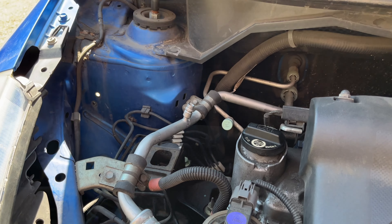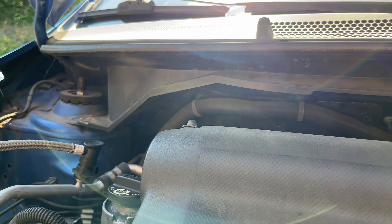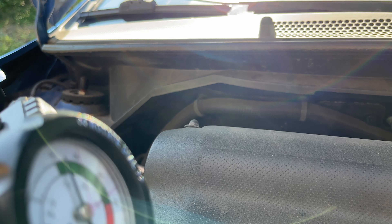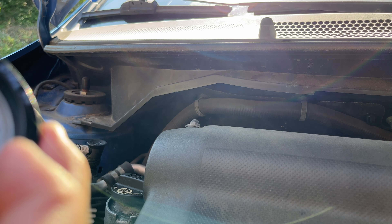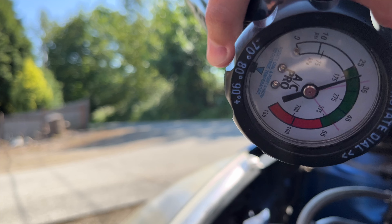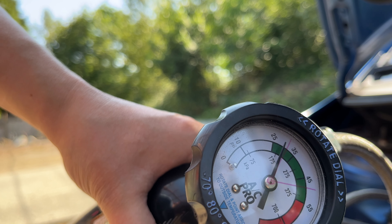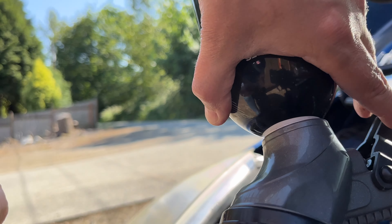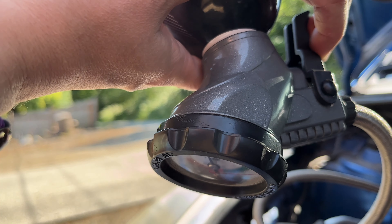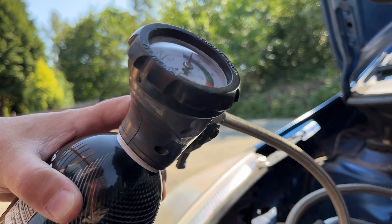This is me doing this all solo. I just pushed that nozzle down, popped it on and it locked right in. Now you're gonna tilt that can of refrigerant upside down when you go to fill it. But first check your gauge and see where it's actually running. My car has been warming up per the instructions for about the last five minutes, with the AC running on high so the compressor is kicking on and everything is cycling. I shake it upside down to make sure it is a compressed gas — you want to make sure you're spraying refrigerant into your car and not just empty air.